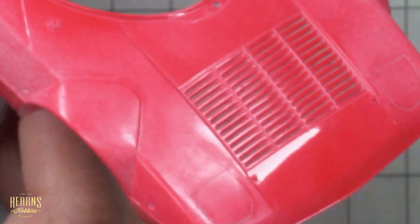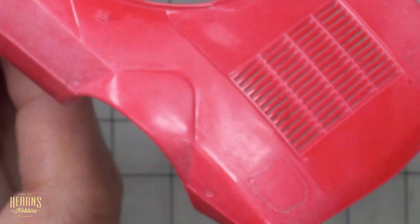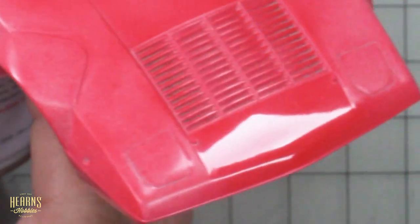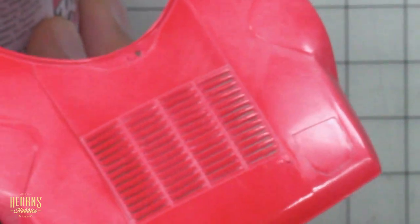Because it's been factory polished to a mirror finish already. And then over this side, you see how you're not getting that same finish, even though we sanded it down with 10,000? That's because there's micro scratches in there. And that's what's going to be eventually covered up with the paint, and we'll get to this point. Okay, so that's the aim anyway.